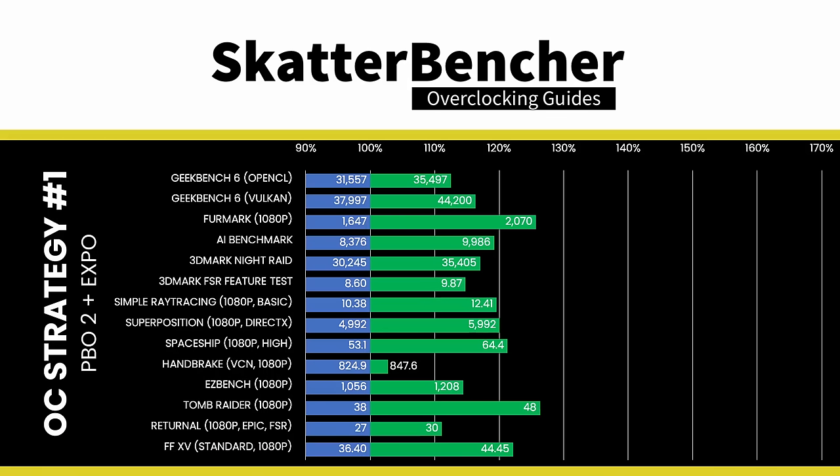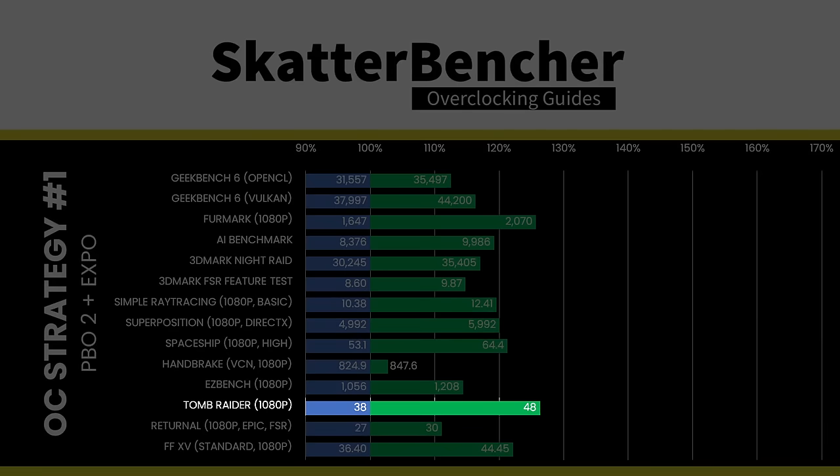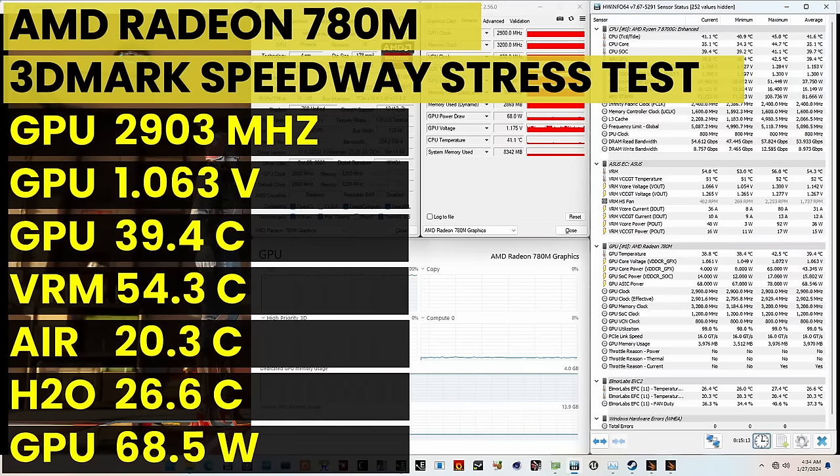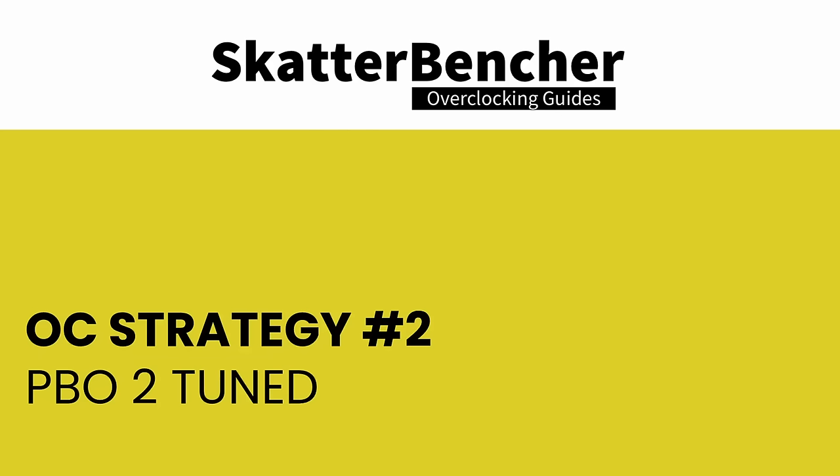Unlocking the power limits and enabling higher memory performance has a significant impact on integrated graphics performance. The GeoMean performance improvement is +16%, with a maximum improvement of +26.32% in Tomb Raider. When running the 3DMark Speedway stability test, the average GPU effective clock is 2903MHz at 1.063V, GPU memory clock is 3200MHz, and average GPU ASIC power is 69W. Under the OCCT 3D standard stress test, the average GPU effective clock is 2882MHz at 1.141V, GPU memory clock is 3200MHz, and average GPU ASIC power is 138W.